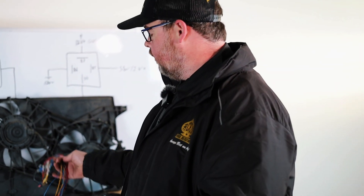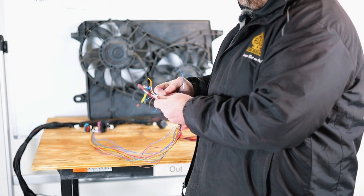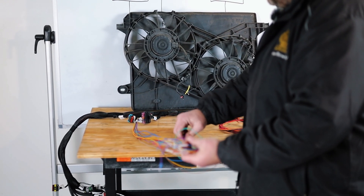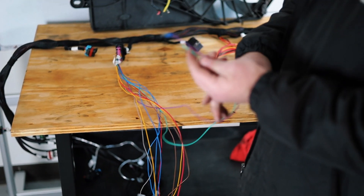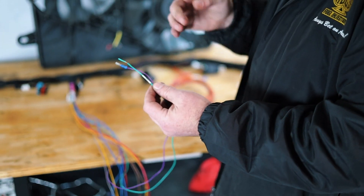I attached the additional wires and that's where the fan magic's happening. The fans are turned on and off with the system on a ground trigger. So let's just weed out where our fan wires are. We got a purple one and a green one — they're a bit tangled. Let's just get them pulled back here. These are the ones we're focusing on today — fan one and fan two. These will trigger the fans and they only supply a ground signal.